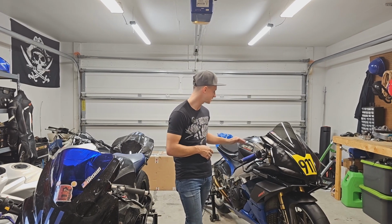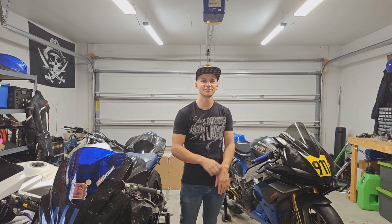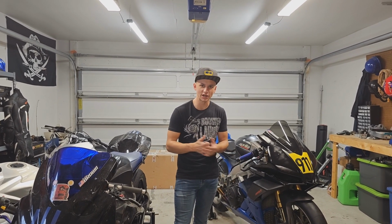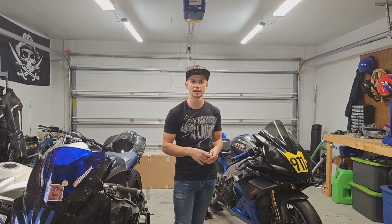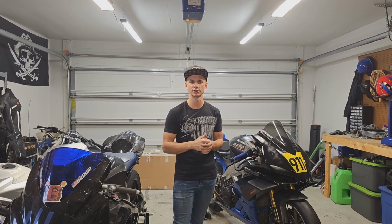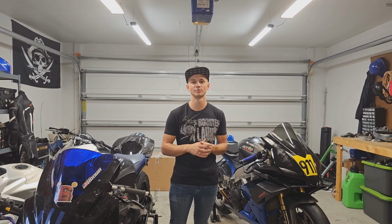The only other thing we have to worry about is dust buildup, right? So come out and dust your bike off every once in a while. Also, you do want to check on it from time to time, make sure that the gravity is not pulling that one spot of the tire down. So rotate your tire a quarter turn every 2 weeks. I'm just kidding, that's not necessary. But check and make sure your battery tender is actually working. Make sure the chain still has that nice film layer on it. Those are things that you can do if you're really missing your bike over the winter.